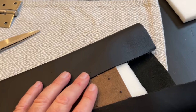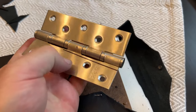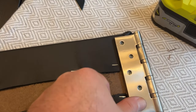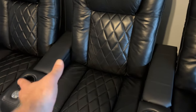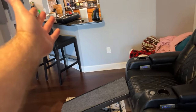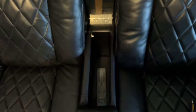With the holes pre-drilled, wrap this side and staple it — with the exception of the very center, don't bother there because the bracket will be going right on top and that's what keeps everything down. I just noticed I showed you marking the wrong part of the bracket earlier — you actually want to mark this here. Same idea though. Got the bracket screwed on, now we can put it back on the seat — even straighter than the original. It is literally five screws and putting the bracket on the original armrest and snapping the spring clip back on — 60 seconds if you want to swap back and forth.